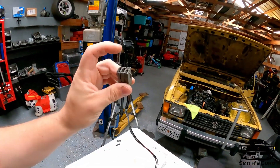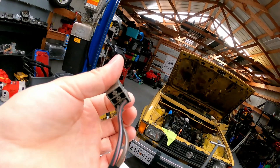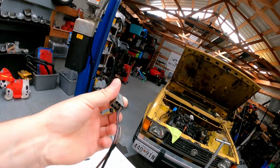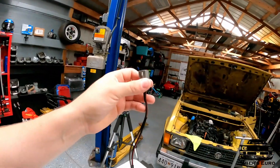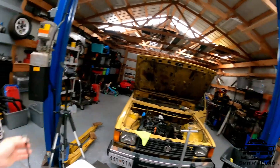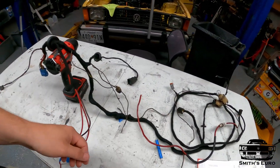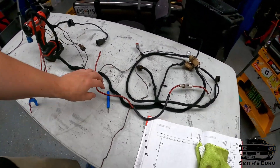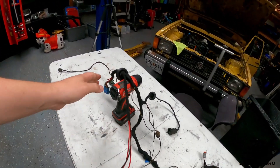This plug goes to the whole AC system box — you can see there used to be six wires in here, technically seven because one was jumped. I depinned all those wires and took them out because we don't need AC. This will strictly just be supplying power to the fan. Up under the dash, this has a direct path right here — this is my direct power to the fuse box.